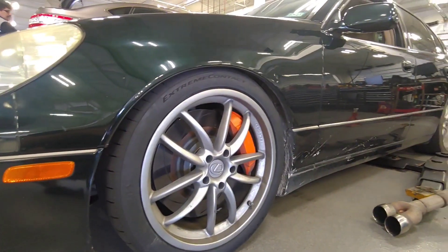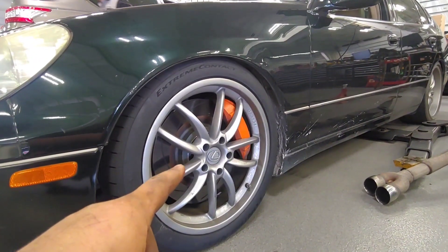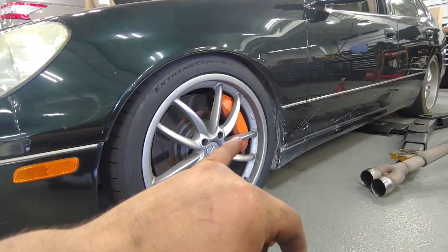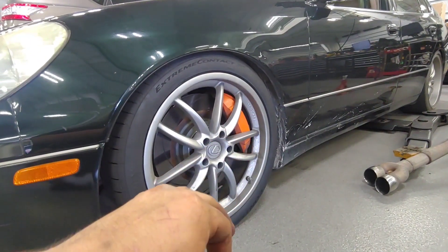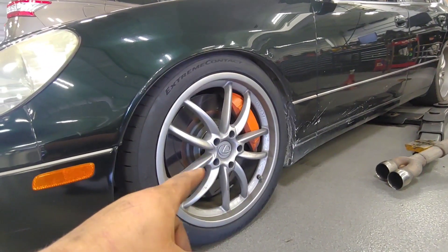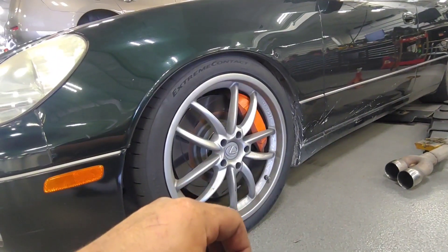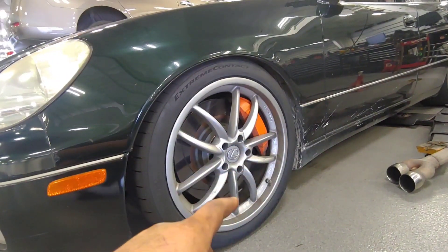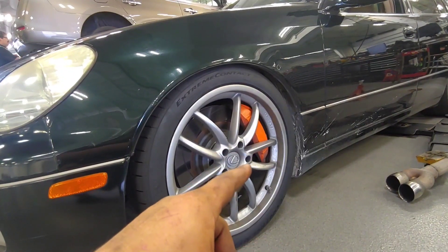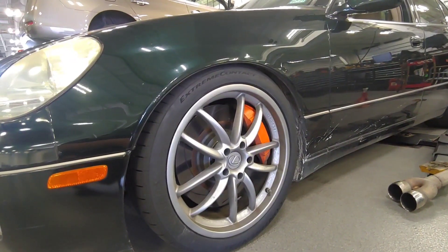For fellow GS owners who ask about the brakes: the rotors are from a 2015 Lexus RCF — a 15-inch rotor — and the caliper is from a Lexus LS 460, but it has to be from an all-wheel drive. The brackets are adapter-type brackets, I think they're XAT Racing — I'll link them in the description. A 19-inch rim is the minimum clearance. Typically with this bracket it's a 14-inch RCF and a two-wheel drive caliper, but I went with something unique: a 15-inch rotor with the AWD LS 460 caliper — pretty much the biggest brake combo I could come up with on this GS.